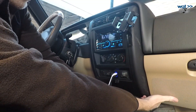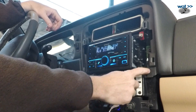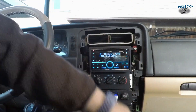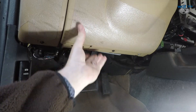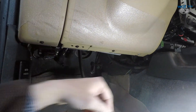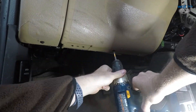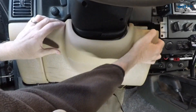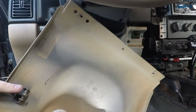I usually like to reach down here and pull from the bottom and the whole panel comes loose. The screws we need to get out to remove this whole face piece are here, here, here, and here. Before we get ourselves in trouble, let's go ahead and put it back in park and pull the key, because for the moment we're done here. Next we need to remove this lower plastic piece — there are three screws along here, all Phillips except one that's been replaced. This panel then has a couple push-in type clips, and that is what we just removed.